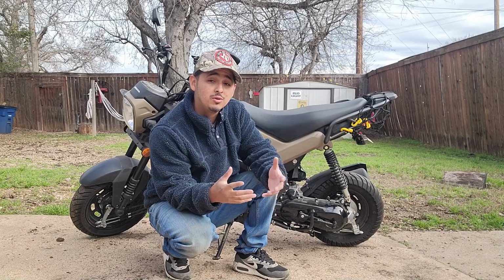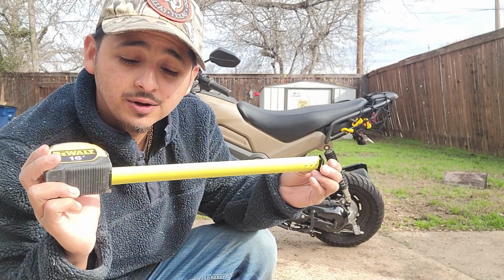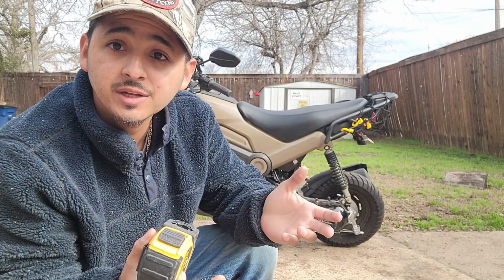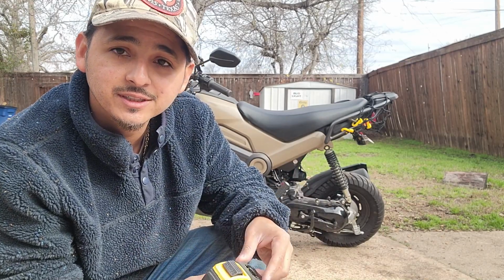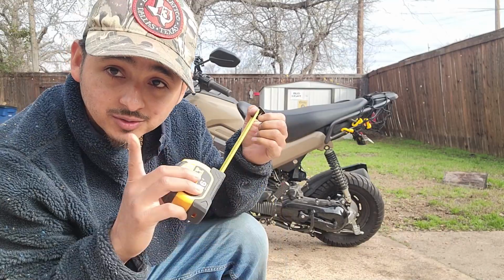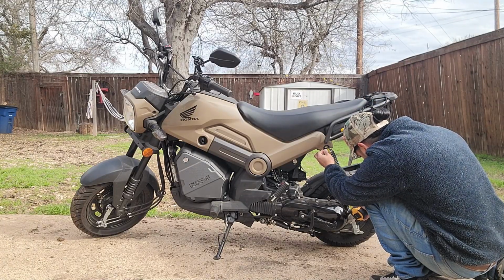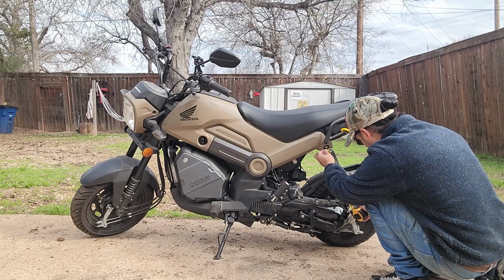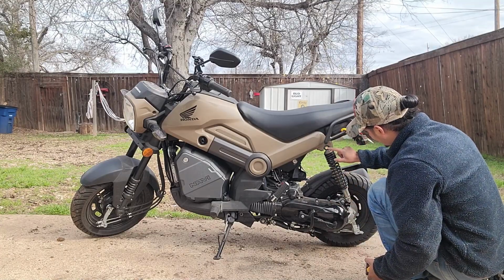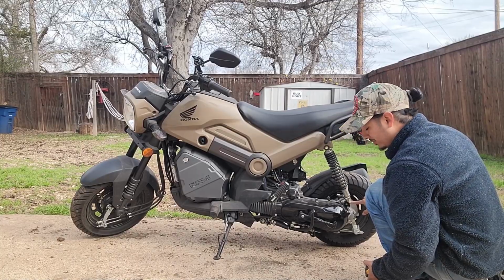They do that combo. Last thing I want to do for you guys, I want to go ahead and measure from eye to eye how long it is. So I should have done it beforehand, but anybody that has a stock shock, y'all can just take that measurement yourselves. I'm gonna get you what matters the most. So eye to eye, again, I'm going middle of the bolt here. We're looking at about 12.5 inches. So 12.5 inches from the center bolt to the center of the end bolt.